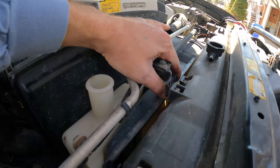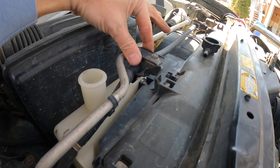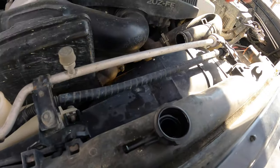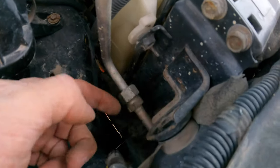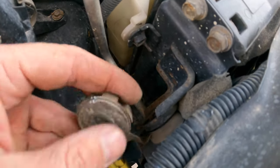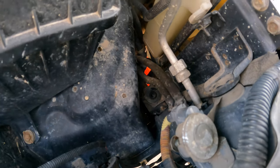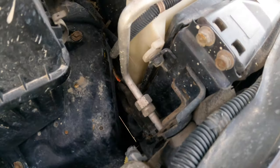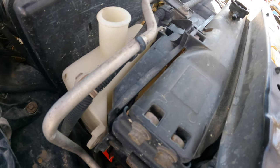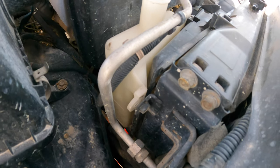My hope is that it'll work out, but basically you can leave all of this stuff attached and just remove the minimum amount of hardware and components to slide the radiator out. Starting at the top here, got this off on both sides — the hose, one bolt on each side. Nut access from the front, you gotta hold that from spinning with a big vice grip, then a large bolt down below. One of those on each side, and the shroud separates easily and slides out from the bottom, so it should be pretty easy to slide up and out of here.